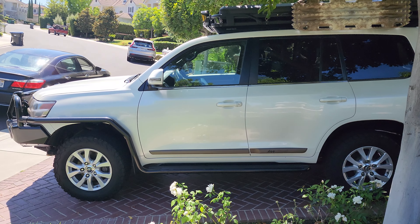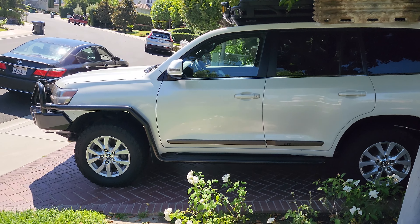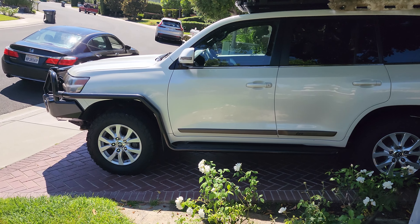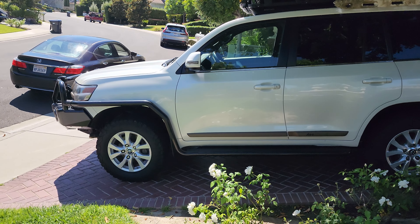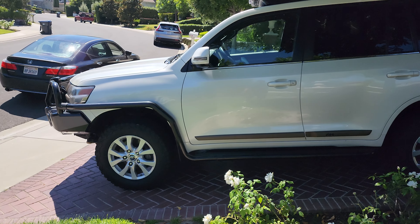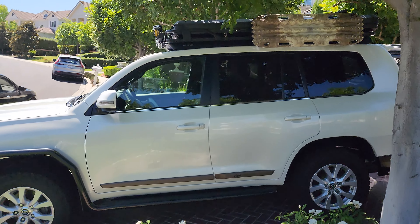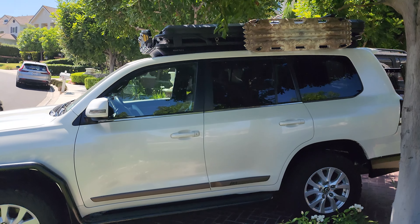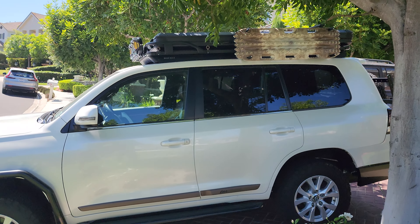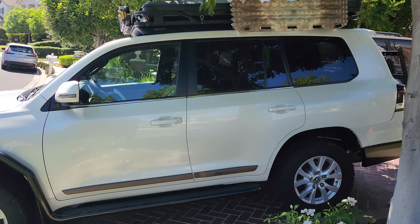This week I'm going to an awesome shop — I'll share it in my next video — that's doing all the suspension. Right now it's got an Old Man Emu baseline two-inch; I'm going to three and a half inch and going from the standard tires to some 315s, which is technically a 34.6, so it's not quite a 35.